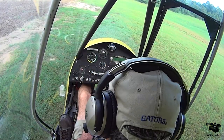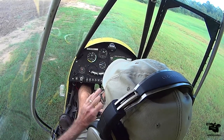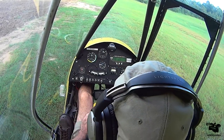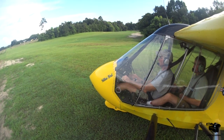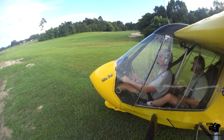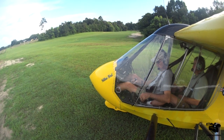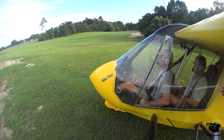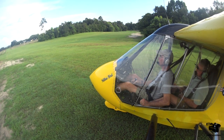Okay, so we're going to do our mag check, right? Does it matter what order we do this in? No. Okay, mags at 4. Go left mag. Drops 2. Go right mag. About the same. Yep. Bring it back. Both. There you go. Okay, that's good. What that's telling you is that both spark plugs are working well in each cylinder.